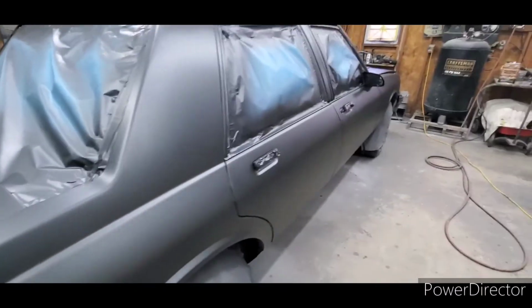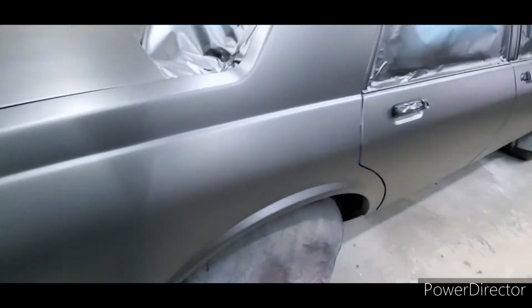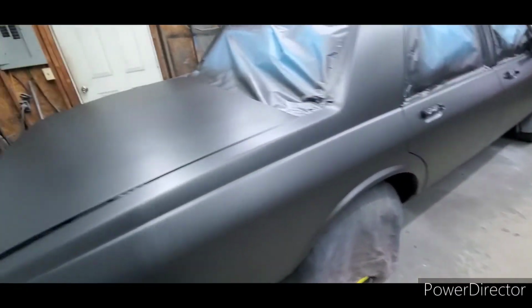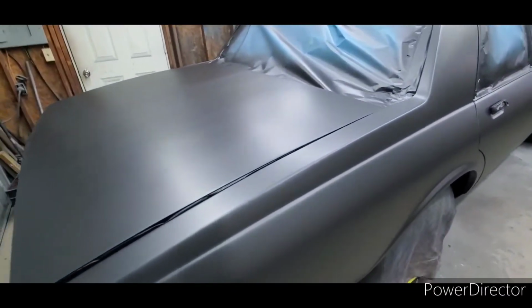You may want your metallic finish to look just as smooth as it can be underneath. That's just not my style. I like that pop. I like that glitter. If it's got pearl in it, I want to see that glitter, and that fan coat really helps with that. It also helps with tiger striping. And that 1.5 tip lets the pearl really, really flow out also.